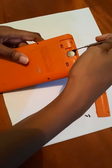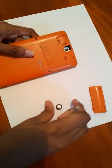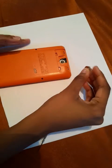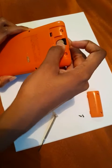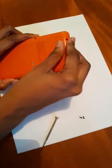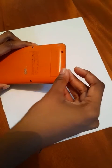Now gently remove the old battery — this one is a coin cell battery, type LR44. Once you remove the old battery, insert the new one. Make sure you're inserting it the right way: the negative side down and the plus sign facing up. Then simply screw the compartment back on — make sure it's secure, but don't over-tighten.